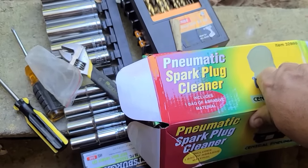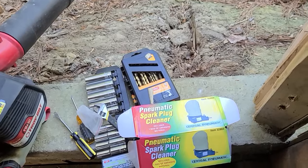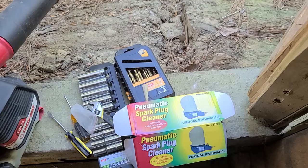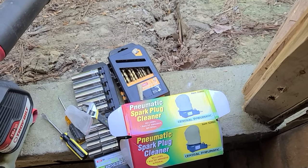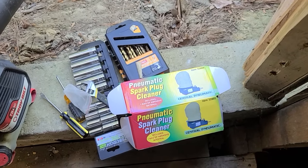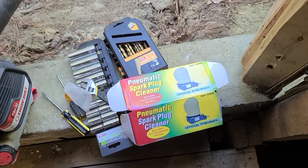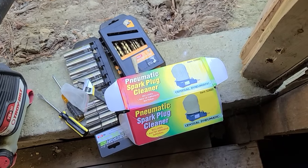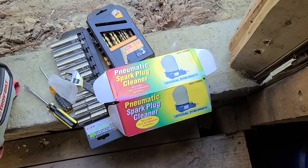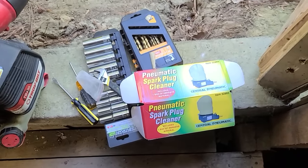That's Harbor Freight — it's about 20 bucks. I bought a pound of media for it, which it came with media, but I wanted extra. Since I have generators and such, it'd be easier to have this. If I get more life out of a plug and I'm unable to resupply — can't buy generic, or whatever — I can always pump up the air compressor with a foot pump if I had to and use this. But you could probably also clean it with brake cleaner and a toothbrush. Either way, I like it and I'm happy with it.